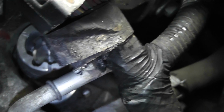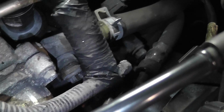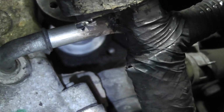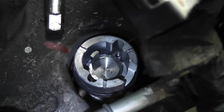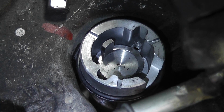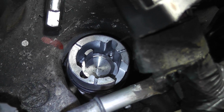So you put the distributor slash cam sensor shaft in, and then you put the tool in, and you line this tool up. If I can do this while I'm, get it to snap in right, and then turn it clockwise until the inner shaft stops on the tool, and then at that point you can tighten the shaft up. And what you'll see is I'm a little bit off of my paint mark, but the internal of the sensor and the body is lined up to the notch on the leading edge like it was before. So that's the key element, as long as you don't turn the engine over with this thing out. So let's put it all back together and see what we got.